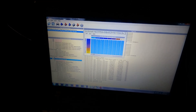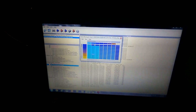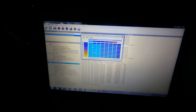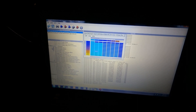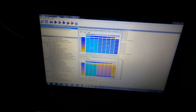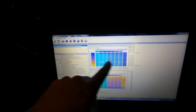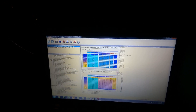Initial wastegate and max wastegate duty cycle are set to the same thing right now — 20% duty cycle up top and 10% in the mid-range, mimicking the shape of the one I modified before. When you do wastegate duty cycle tuning, you want to start at zero and just work your way up until you hit your boost targets. For this setup, I'm probably not going to have to mess with it too much, because I'm already almost at my targets at zero wastegate duty cycle. We're going to do a pull and see what it does, then come back and look at the data.